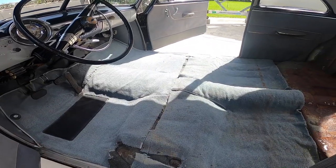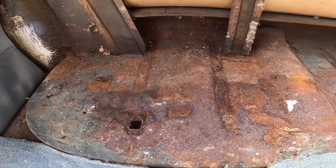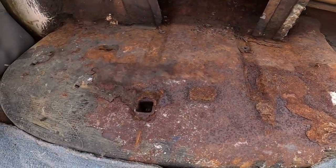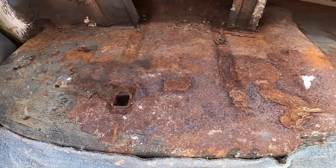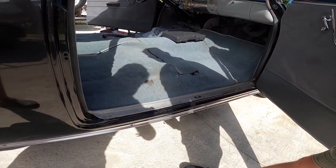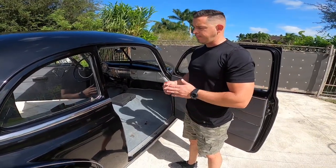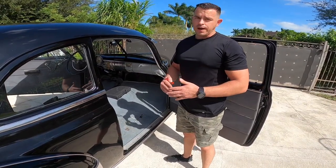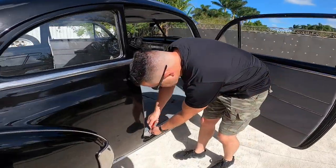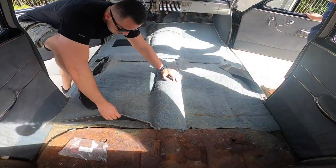This is how the floor of my 1950 Chevy looks like. To be honest with you guys, not that bad for being 70 years old. Yes, it is a little rusted but nothing that I cannot fix with a little bit of rust oil and sandpaper. These holes that you see here are not caused by rust — that's actually where the bench seat bolts. The next thing that we're going to do is remove the quarter panels. In order to do that there are seven screws that we need to remove. Once we take those off on both sides, then we can proceed to remove the carpet. We want to remove the carpet in the best possible way because we're going to be using the old carpet as a mock-up to measure the new one, to make sure that it fits.